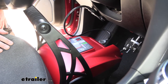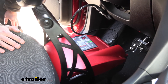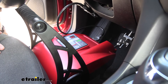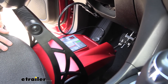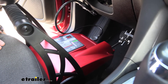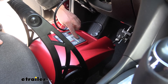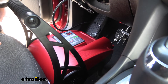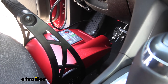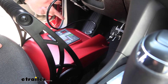Once connected, you should hear the unit run through its initial setup. Hit the auto start button and it should start depressing the brake pedal — this is a self-checking mechanism that makes sure the pressure is correct. It does this about five times. After that, it gives you a readout: an error message would indicate something was incorrect, such as too much pressure on the seat or the unit not receiving power. In our case, we have the green light next to 'normal,' so everything is working correctly.